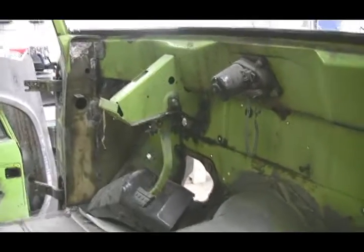The front extension plate of the interior of the roof had been eaten away by rust right where the rearview mirror and passenger side sun visor clip would be attached. Luckily, one of our parts vehicles had a mint one, so we removed it and perfectly fitted it to our Dude.